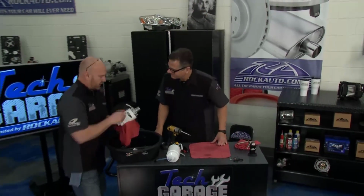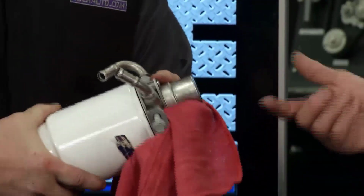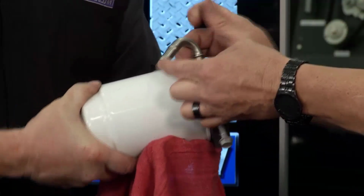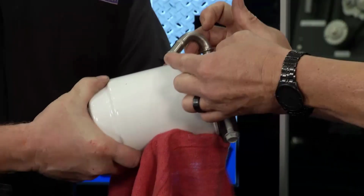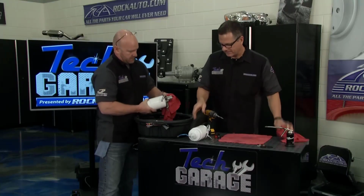There you go. I'll tell you what, I put this mounting bolt back in, got it in the vise so I could secure it. Right. Used a strap wrench, and I broke this guy loose. There you go. So we're loose. Tighten it up for a second. Yeah. Check this out. Here's our primer, so I'm priming it. Sometimes I get fuel, sometimes I don't. Oh, look, made a little fuel, cool. Yep. So it'll work intermittently. That's probably where we're sucking the air for sure.